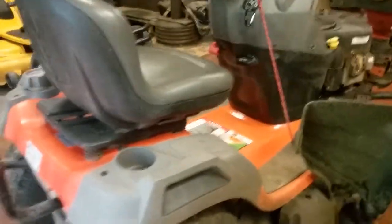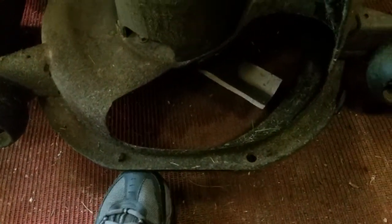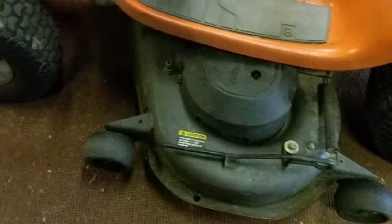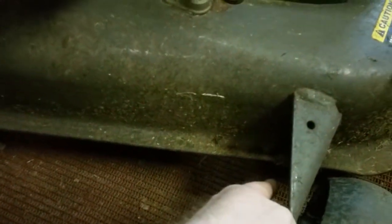The other thing we've got to do on this lawnmower — we did a previous video on how to properly seal the tire. This tire had zero pounds of air in it, which was making the deck on this side touch the ground. Just for reference — not running, folks — you should have about an inch of clearance above your toe on both sides. Measure from a fixed point beside your wheel to the ground up to the deck. On this one it's about three and a quarter inches; check the same fixed-point measurement on the other side and they should match.